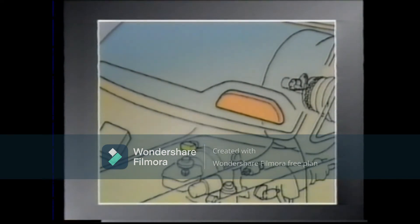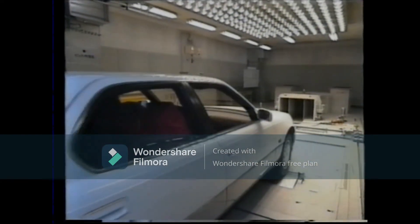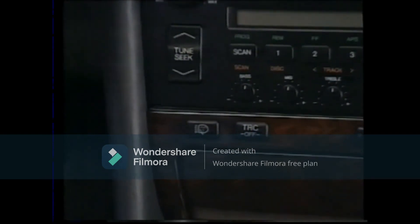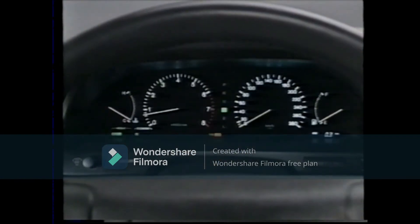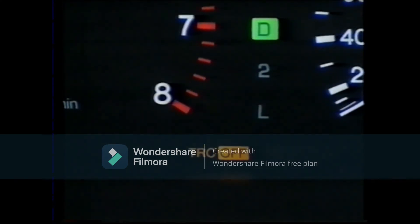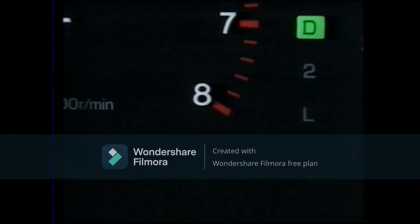Let's see the switch and indicator lights. When only the rear wheels are rotated on a chassis dynamo, for example, you should make sure that the TRC system is turned off by means of the TRC cutoff switch located on the center console above the ashtray. When the TRC system is turned off, the TRC off indicator light in the combination meter turns on. This light also lights up when a malfunction occurs in the electronic engine control system or in the ABS system, indicating that the TRC system is now inoperative.